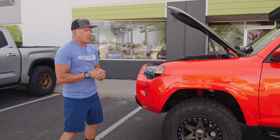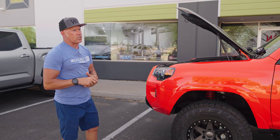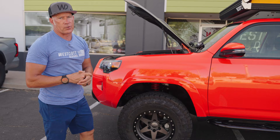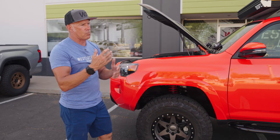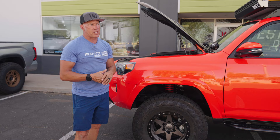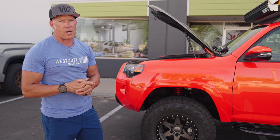I didn't mention the back suspension, but it has a 2-inch Icon rear spring in it. We actually ran a Firestone airbag inside the rear springs on this truck for the added weight depending on how we're configuring the truck. The reason we did that is so depending on what we add or take off, I can offset the truck with those airbags. The great thing is I can completely deflate those airbags and it doesn't affect the off-road capability or the way the truck drives off-road.